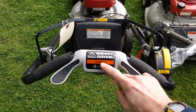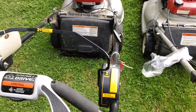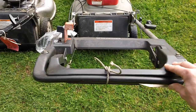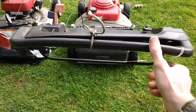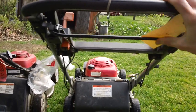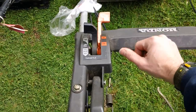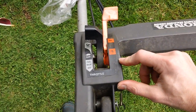It's this smart drive control right here as well — two little paddles for that. And you also have your blade control over here. On this one, you simply have one big bar for your bail control. And underneath here, you have your drive control for the drive. Here's your speed control: your first gear, first selector, and second gear for the second selector. So you have two gears — one and two.